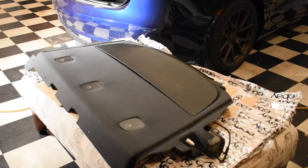If you have an SR or SR Plus Tesla Model 3 and you do not have speakers, which you can check by shining a flashlight through your speaker grill, you may need to change your entire rear deck. The reason is that the wiring harness that runs back there only has two wires for the brake light. There's no wiring harness for the speakers.